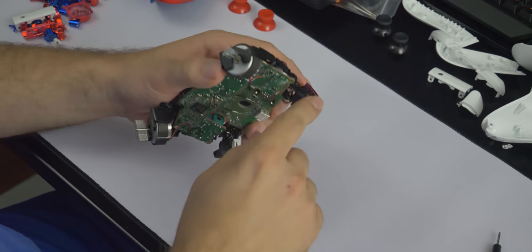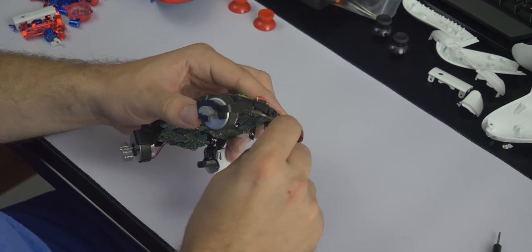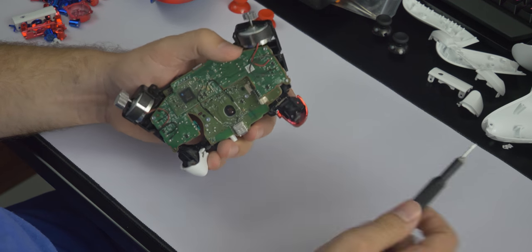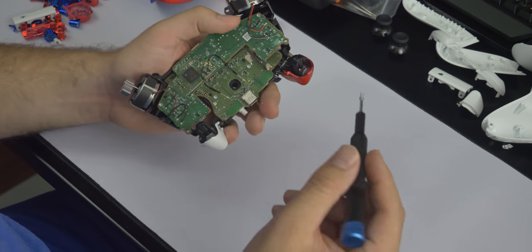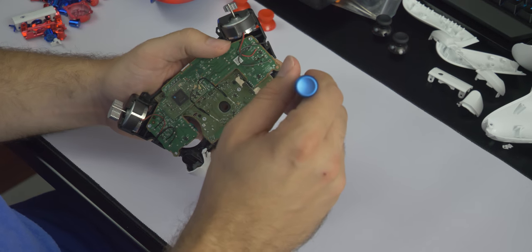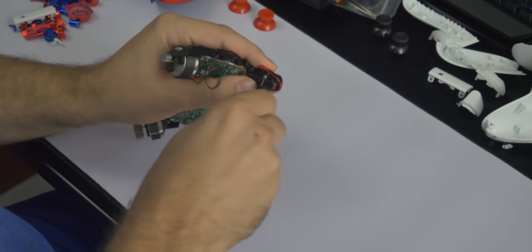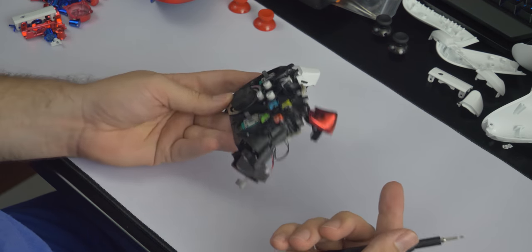I got it on perfect. The way you can tell if you have it on correctly is if you look at the bottom of the trigger there's actually a little tooth that plugs in. If the tooth isn't plugging into that spot, you missed the vibration motor's location — take it back off and situate it so it works better. With that we're just going to take our screw back in. Remember that the triggers are actually based off of magnets, which is pretty interesting. This little magnet trigger actually triggers it, so watch out because your screw can get grabbed by the magnet. There is our red trigger looking good — that's already taken care of.